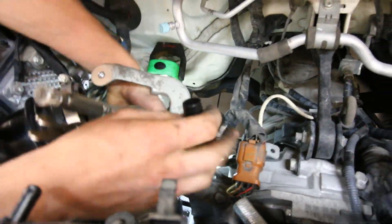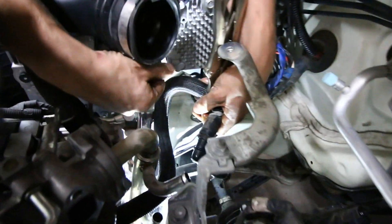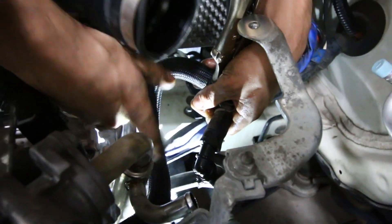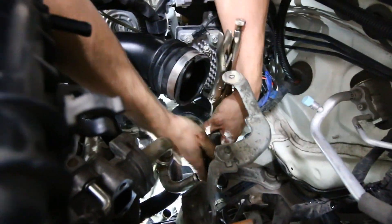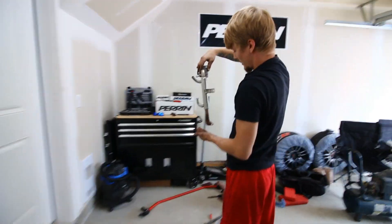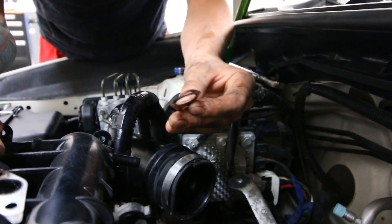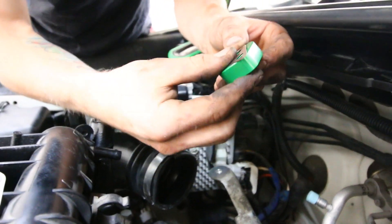So this line is pinched off — remove the clamp. A little splash, that's it. I pulled the two coolant hoses off the main EGR pipe and now we're joining them together with the elbow provided in the kit. There's going to be some coolant. You have to replace the EGR gasket with a new one and then put this block-off plate over top of it on the back of the engine.